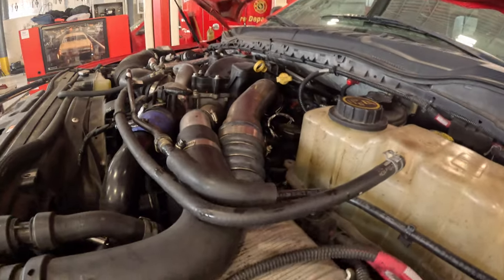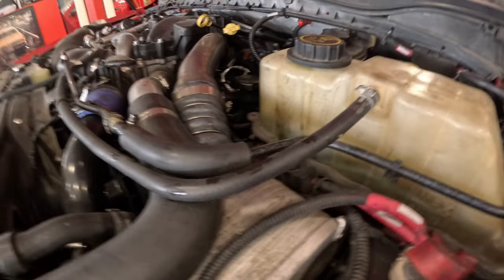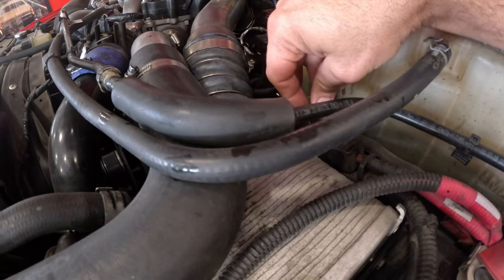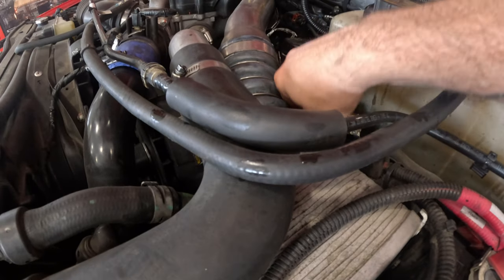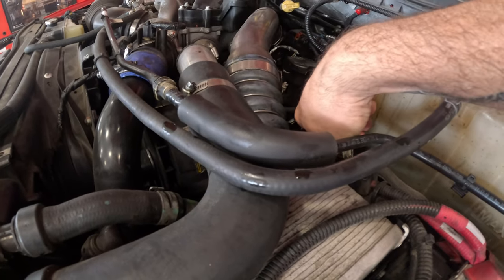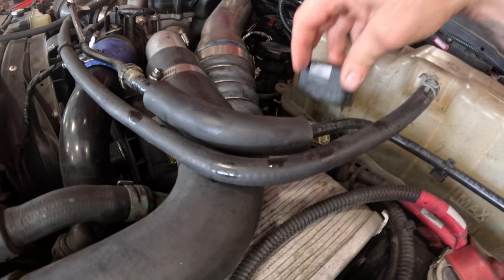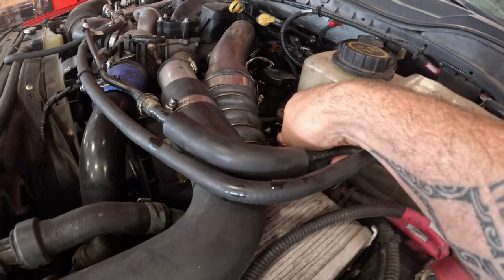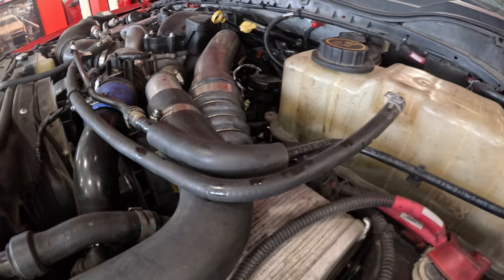First thing's first — let's take our old fuse out. Scarred legs, get rid of it, install a new fuse. I try to push these terminals back together as much as possible. It fits in there pretty tight and secure. I just don't know why they use this maxi fuse instead of like a black midi fuse. Coming back on there, we'll be good to go for a while. Let me show you guys how to recalibrate this.